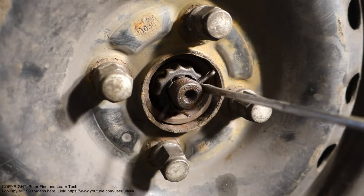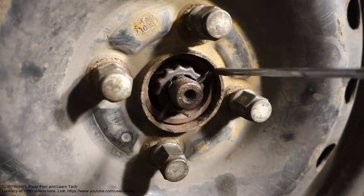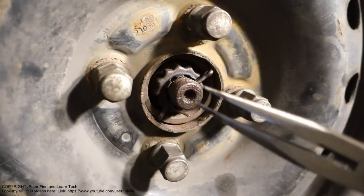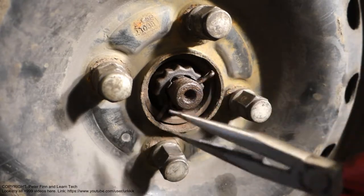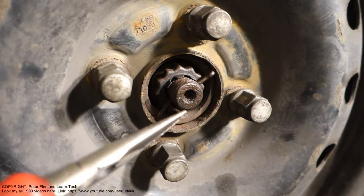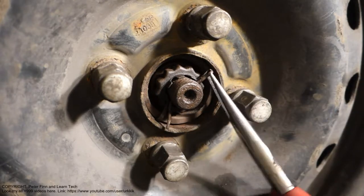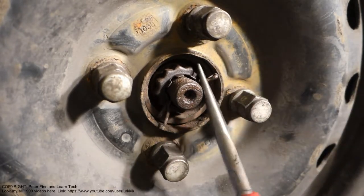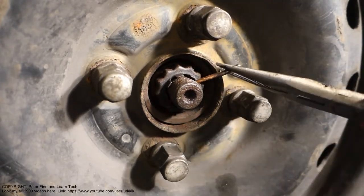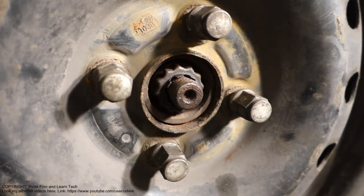Then an important part: in this central area there is a nut and this protective locking pin. For opening that we need these tongs, and the idea is that first I need to take this metallic pin away. What is very important, now I rotate that, and then I start to pull it out a little bit in this way, and there is this old pin.